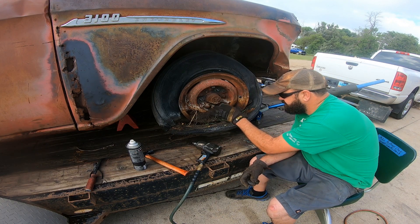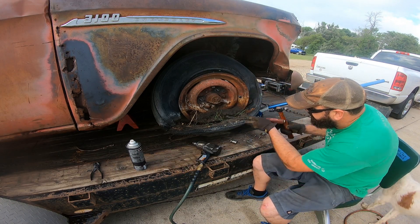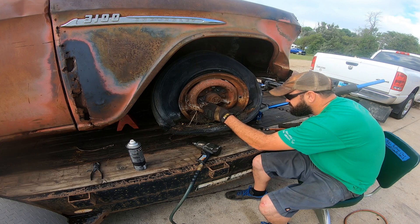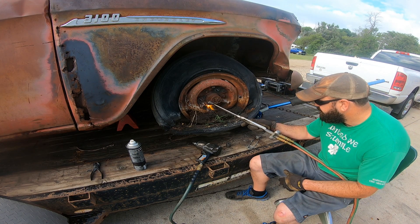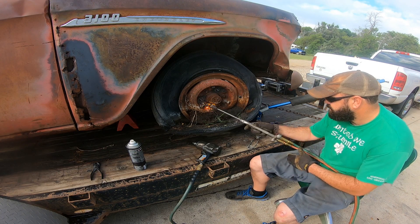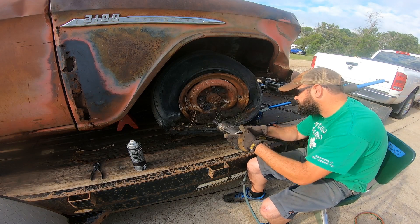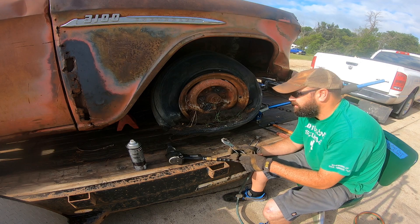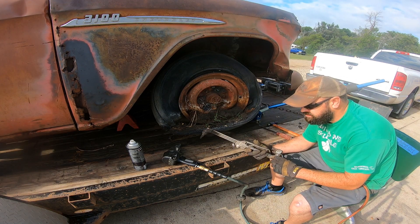See if we can get a... oh yeah, the socket don't even want to go on there. Let's get something to knock that debris off there. The socket's warm yet. It's like a sparkler in there. You're not gonna want to grab that lug nut right away after you warm her up with the old gas axe — she's a little warm. Let's try heating up this last furry oversized lug nut, see if we can't melt her down to dimension so that the three-quarter socket fits on it.